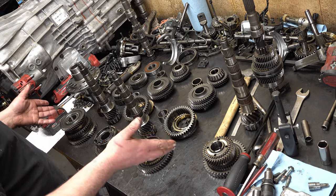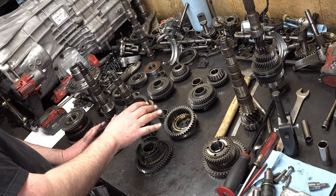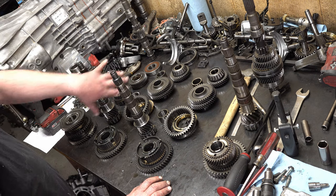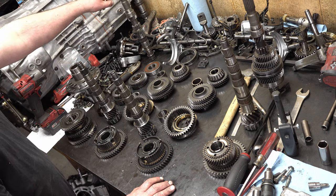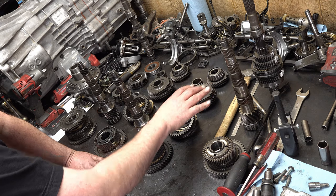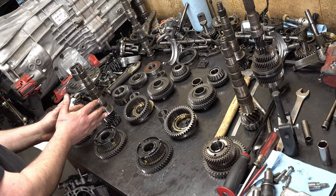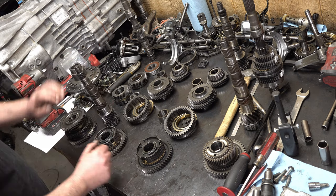And this is the kind of puzzle that I enjoy. Right here is the RAV4 output shaft — the shaft itself and everything that's on it. I did figure it out; I counted the gears and whatnot. This is an E56 output shaft, and there's the input shaft itself so that I can inspect the gears. Though all this stuff here we're not going to use. Essentially we're going to take this output shaft from the RAV4, put it in there, and reassemble this stuff on it — that'll change our final drive because this is what drives the ring gear on the differential.